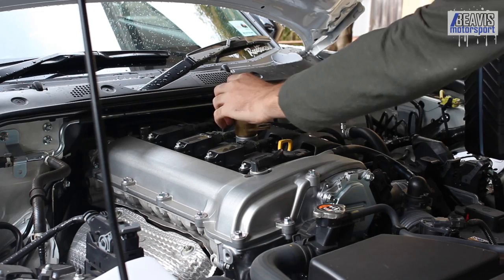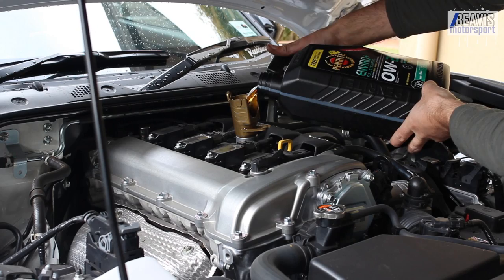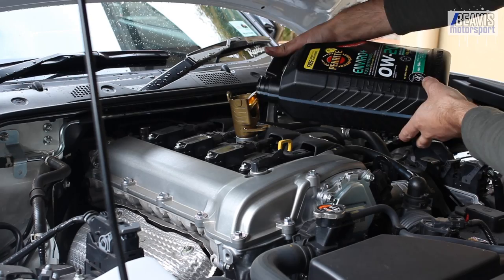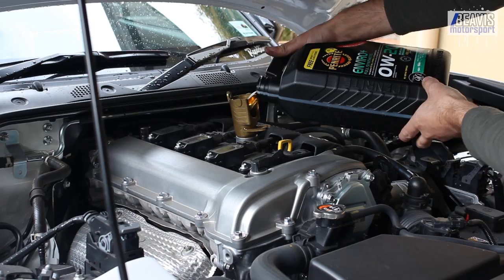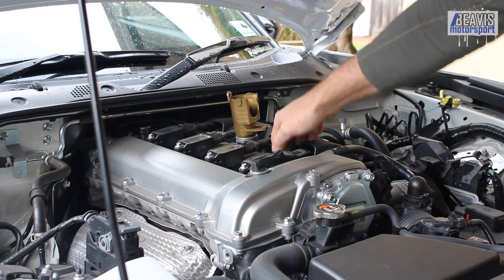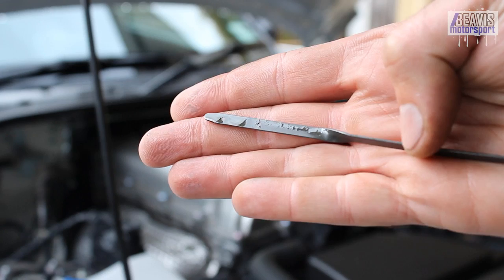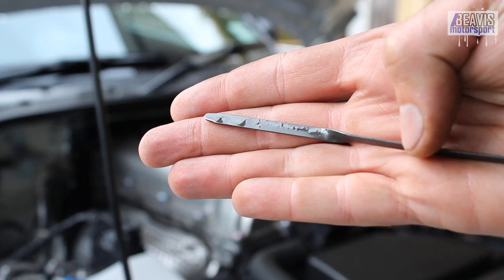Back up top - the car takes about four liters, so my usual method is to add about 500mL less than that and then double and triple check the dipstick. So I'm going to put about three and a half liters in here with my little funnel. Then I need to let the oil settle for a moment - if you check the dipstick immediately, there tends to be a build-up of oil on it as it drains down. So I usually fill the oil, give it five minutes to settle, then double check the dipstick. You can see here when I first check it the oil marks are sort of halfway between the low and high dots on the dipstick - the two dots are your low and high marks - so I'm right in the middle, probably needs another half a liter or so.